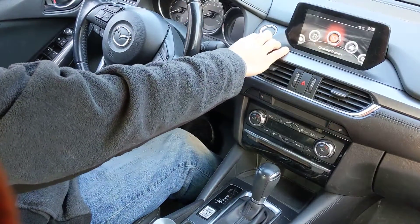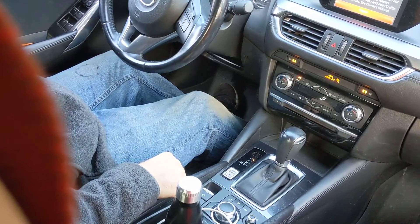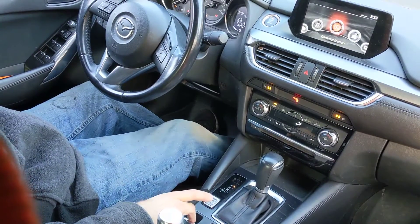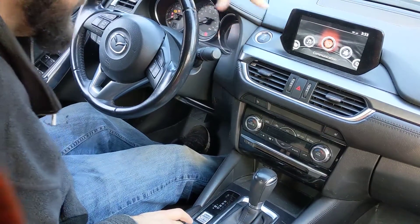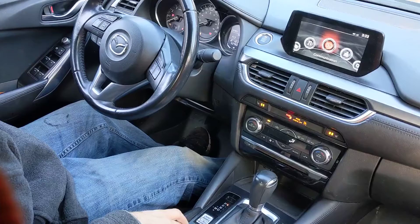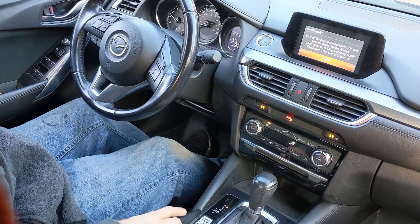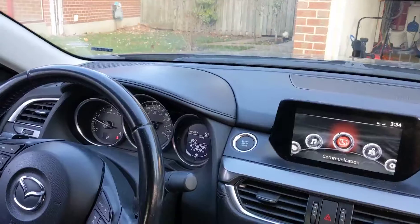Let's say we have now worked on our brakes. The car is currently off. We are going to turn it on with two button presses. Okay, we have got this light here — yellow P with the exclamation mark. Again, foot down past the click. This time you are going to push the electronic parking brake button up, and then the same — one, two, three. Hopefully what you just heard was it engaging and adjusting. And now our parking brake is working like normal and the warning light is gone.